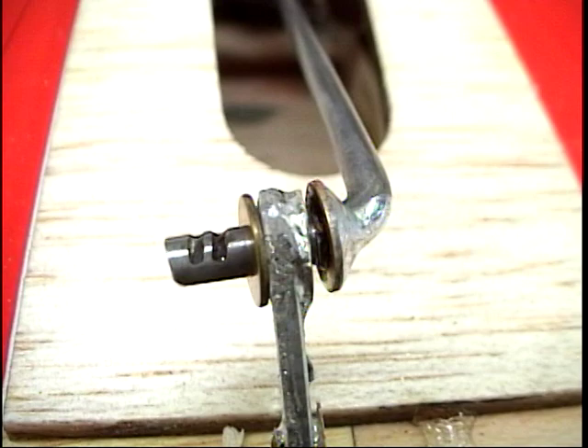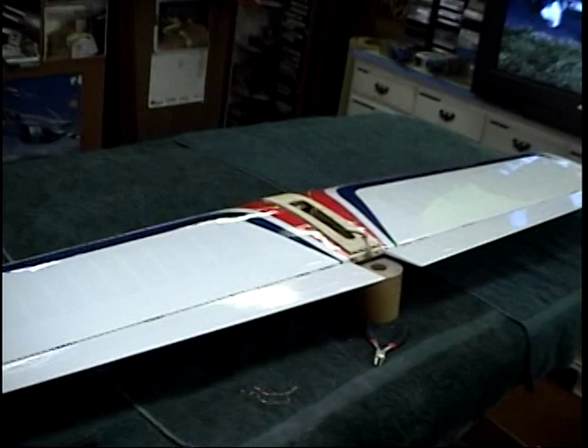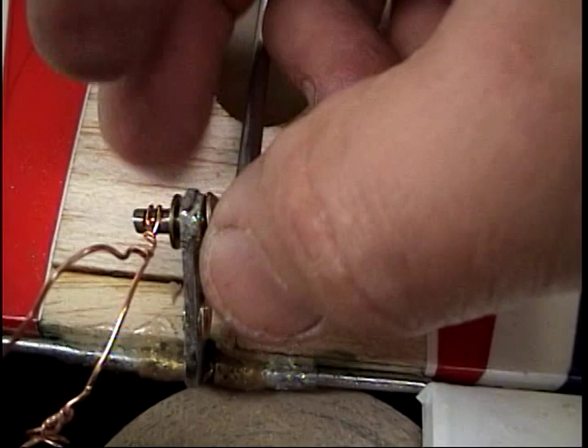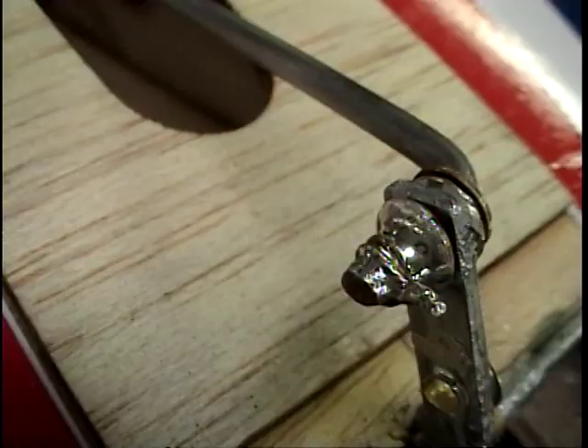While I have it in place, before I do the final solder, I'm going to work the controls and make sure I've got neutral — same amount up, same amount down. When I solder that washer, I'll take that clearance out. With that safety wire, it just acts as a safety part. Now with that soldered and tacked, I need to make sure everything is in neutral and that I have equal up and equal down.